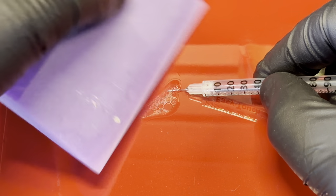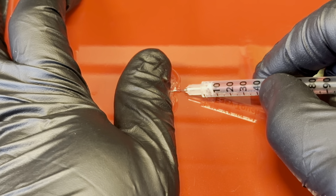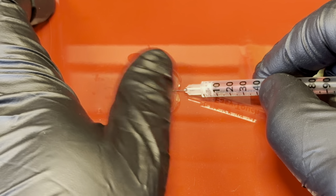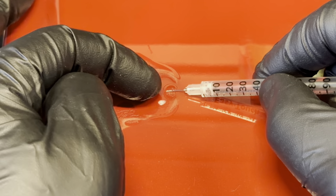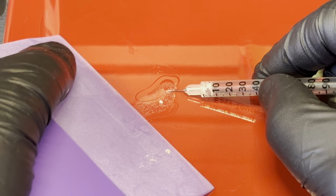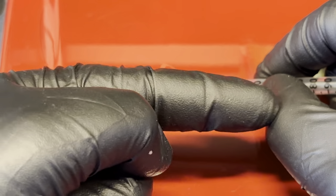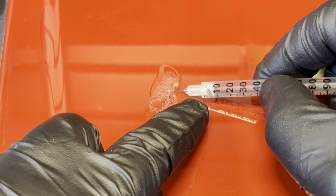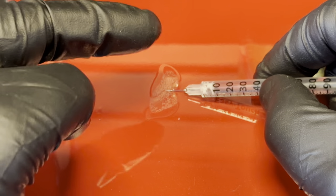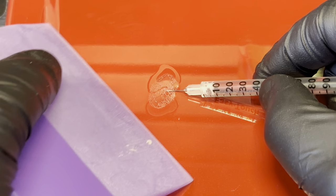If this were smaller, or if it had sat for about an hour, it would have already shrunk down to an isolated moisture pocket. I can take my finger and roll it right up onto the needle without any worry of stabbing myself because the bevel is facing up. This hand is not moving — it's rested on the paint, holding the needle right where it needs to be. If you had the plunger section in the back and were trying to pull it out, this tip would be going all over the place. I want it stationary, feeding all the fluid right into the tip.